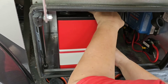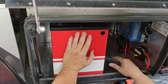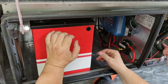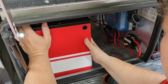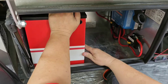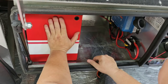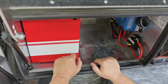The beauty of using these 302 batteries in a Wonder is you don't need a bus bar when you add a second battery like you do for the Unity, because you're just going to wire the batteries right together and take off opposite points. You do the coach battery connection on the positive terminal of one battery and the negative on the negative terminal of the other battery. It's really easy to upgrade to a second battery in a Wonder — you can put them side by side and wire them together instead of having to use a bus bar.